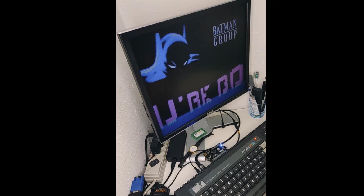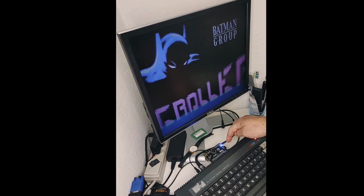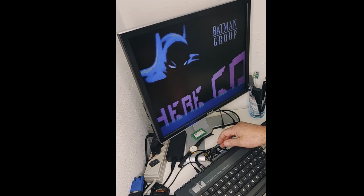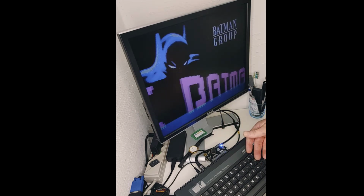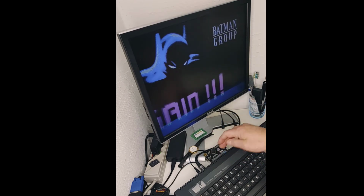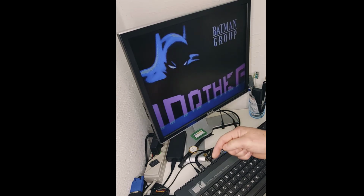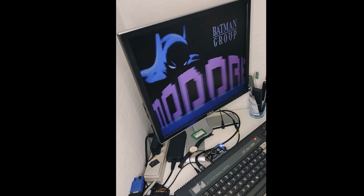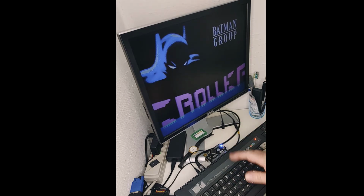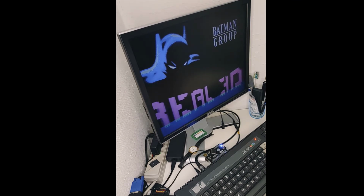So it works. So what we've succeeded in doing here is we've formatted an SD card. We've inserted the formatted card into the M4 board. We've configured Wi-Fi on the Amstrad CPC so that every time we turn it on with this board in, we'll have access to the internet if we want it. Plus, that also means that we can conversely go to a Windows PC or a Mac or whatever and remote from them to the CPC. In other words, copy files, copy games, whatever. So this opens up a whole bunch of new capabilities, and that's what we're going to see next.